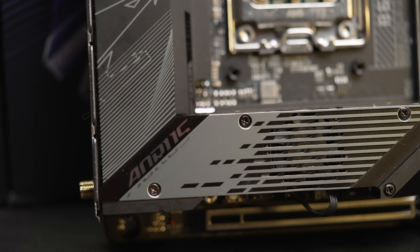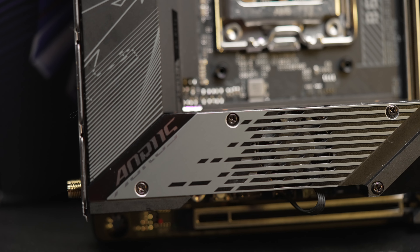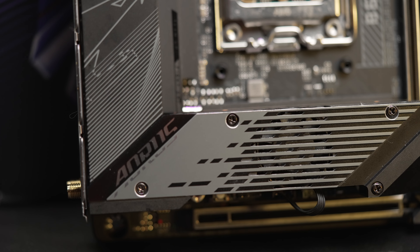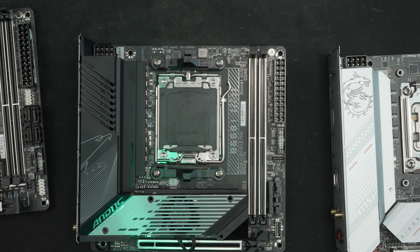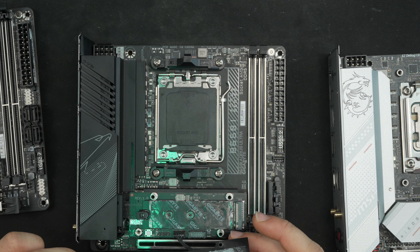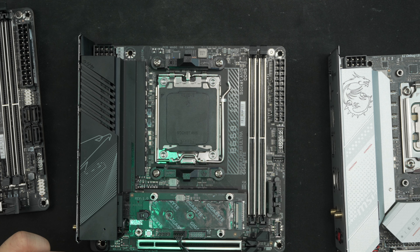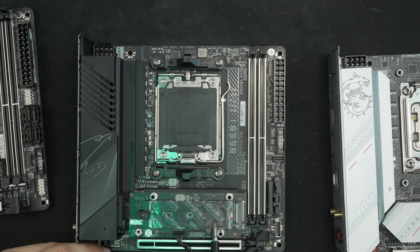That's why you have this mini fan directly over it, contained in this heatsink. The fan's purpose is to actively cool your topmost M.2, not the power delivery. If you study it, this topmost heatsink is an independent chunk that only makes meaningful contact with the top M.2 drive. This other thermal pad underneath doesn't actually touch the drive, so I'm not sure why they did it this way.